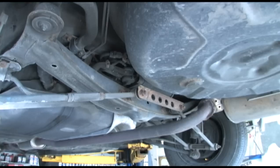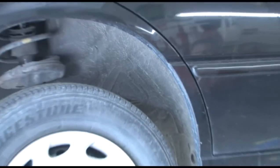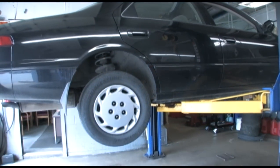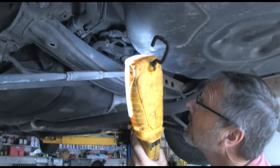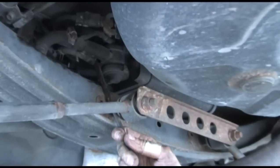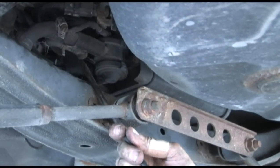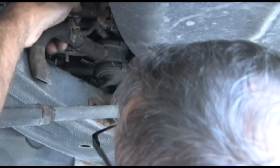This canister is located over the rear suspension, just in front of the fuel tank. The only way to test this problem is on a hoist, so up she goes. Even on a full hoist, the canister is not easy to get to. First we check the hoses and electrical connections — everything looks good here. It's time to pull the canister and perform a bench test on it.